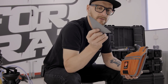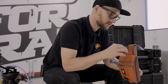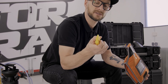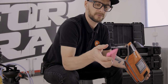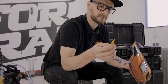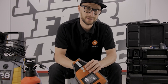What else? A glove, of course. This one is pretty used but I really like it — it still does the job. Then for paint protection films, I have three squeegees: the yellow one, which is the soft one for bulky elements; the pink one for flat surfaces — this is the stiffer one, but it slides very well on every PPF film I use; and then for very angled curves, a customized squeegee — I don't know what it's made of, but it's a very, very good tool in my opinion. Very important are also the magnets.